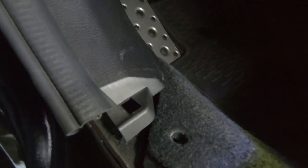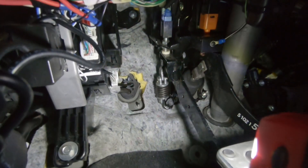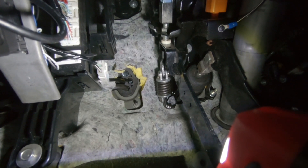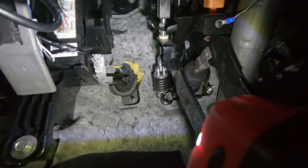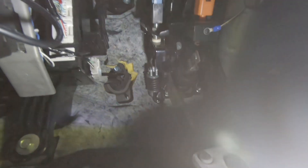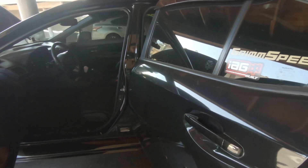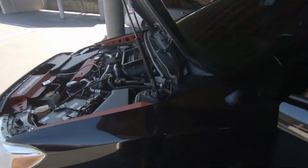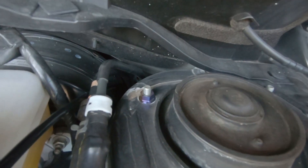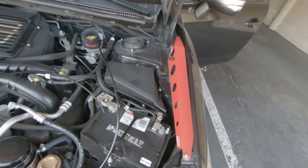Nervo's tutorial is awesome — it actually shows you right here the meth line clipped into the body clip. I ran that forward, basically following the fuel lines all the way under there. You can see that the methanol line goes through the grommet right above the fuel line right there. You just have to use a little drill bit and poke a small hole through it. The holes are actually pretty big so you can run the wiring through as well. You just have to remove a few trim pieces along the panel and that made it pretty easy.